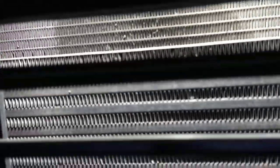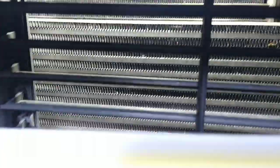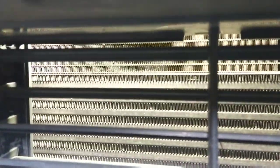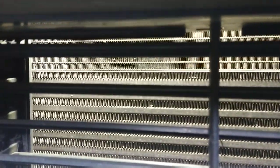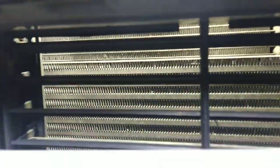I can just make out a very slight dark patch, and I think the leak is going to be behind the intercooler. I'm going to spray some bubble solution on the part I can see. The intercooler is just getting in the way of where the leak's likely to be, so I'll probably take the bumper off and pull the intercooler forward to double-check before ordering any parts.